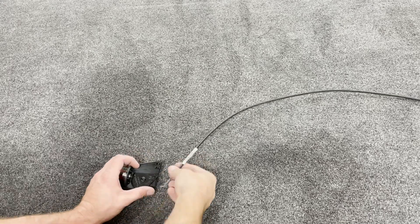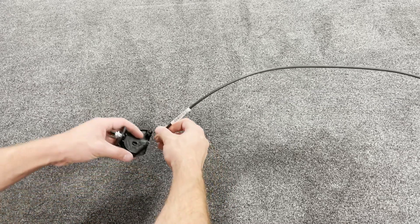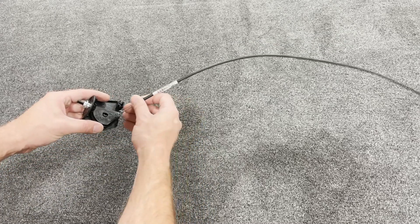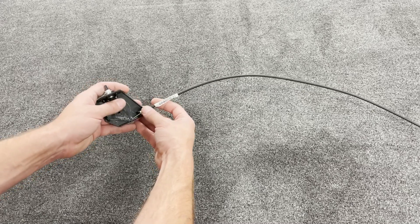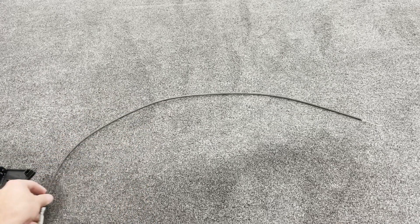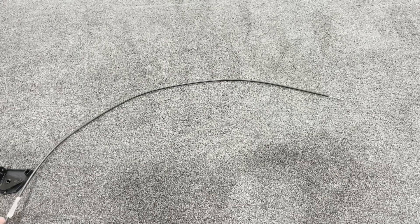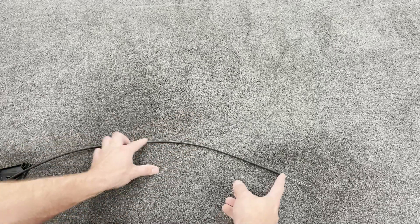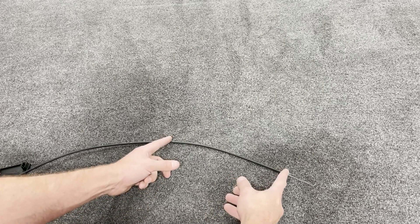The other end of the connection is as you see here, and both connections are made the same way. You'll slide the metal end of the cable through the outermost hole here and place it down. Then take this end of the cable and rest it in here — just press it in and it will click into position. Sometimes these cables are a little too long for your application, so fit it onto the plane with your panel in place and see where the cable rests first.